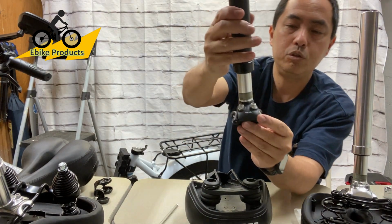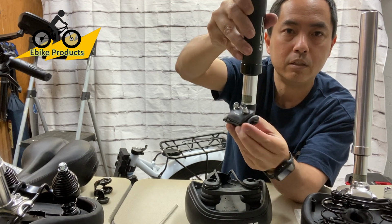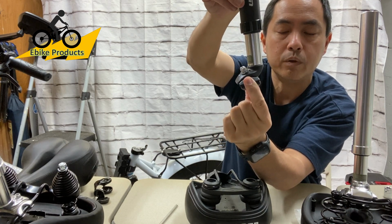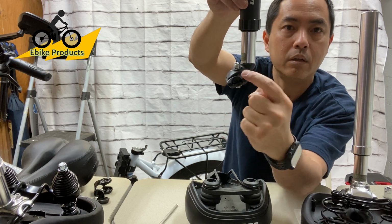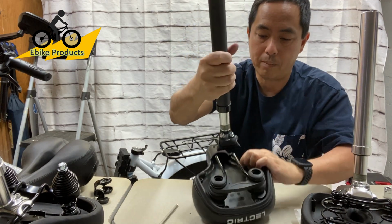take this off. What you'll see also is that this is the same type of teeth ridging. So basically this is how you can adjust the tilt of it. So when you find the right tilt, you tighten it down, and the teeth grab within the 2 areas that are right here that come in there. So again, make sure that you're putting it in so that these screws are toward the back.